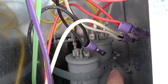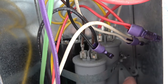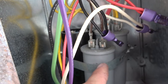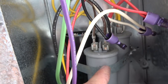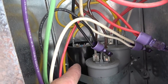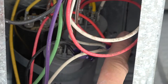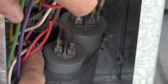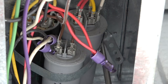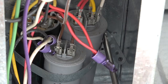Let's give you a quick look at the capacitors. This capacitor in the back here on the right hand side of the picture is a run capacitor for the compressor — the gray one. This front gray capacitor is a run capacitor for your fan motor. And then over here the black capacitor is the one we're going for today — that is your start capacitor for the compressor. Now that we're inside here there is a screw right over here on the right hand side that holds this metal piece in place that holds all the capacitors.